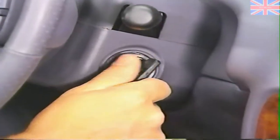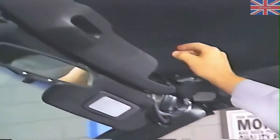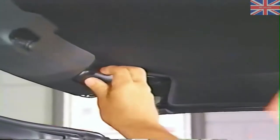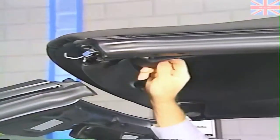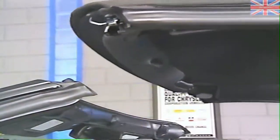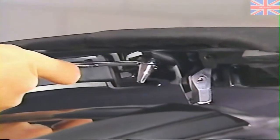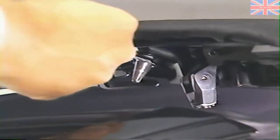The relay coils are powered by the power top switch located in the floor console. The ignition must be on, and before lowering the top, it must be unlatched from the windshield. As on LeBaron, you need to close the latch handles before lowering the top into the storage area or damage to the top could occur. The convertible top adjustments on Sebring are similar to those used previously on the LeBaron convertible. If dowel pins are not positioned properly, they could cause top to windshield misalignment. To adjust them, loosen the pins, position them to center in the retainer holes, and tighten them.